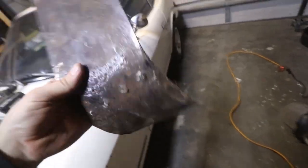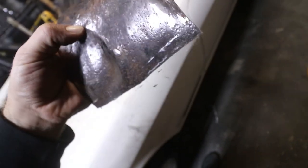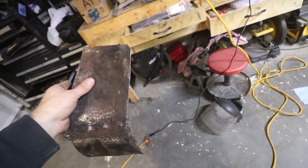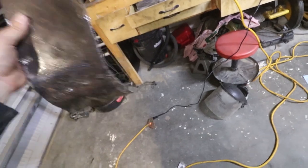We have our piece cut out. The rest really wasn't that bad - it wasn't really going through. Just those pinholes that you can see right there, and there's another one right there, so it really wasn't that bad. A lot of people probably wouldn't have replaced it, but it was getting pretty thin. So this should be relatively easy to patch - it's always funny when you say that and then it's not. But we're going to grab some steel, got some sheet metal over there. We're going to lay this out, trace it out on the blank piece of steel, and then we'll cut it out.